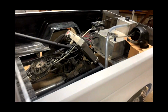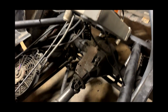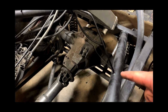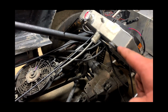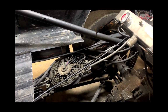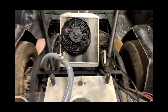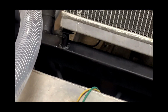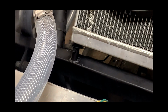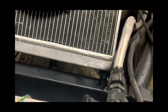But here's the meat and taters of this conversation. We just took some, I think it's 1/4-inch round rod, come across, mounted it, put a little rubber spacer there, but over there it mounts back up. And on the bottom, what we ended up doing, and I will center that fan, I know Tackett's going to kill me if I don't. I put some little dowels, and there's aluminum rod comes off the radiator anyways, so I put a couple self-tappers, that way it couldn't exactly move forward.